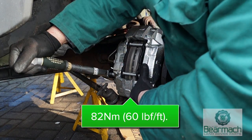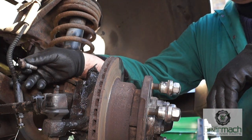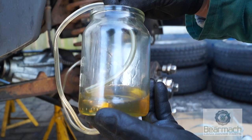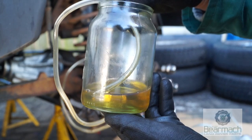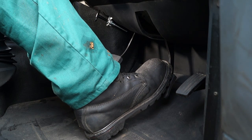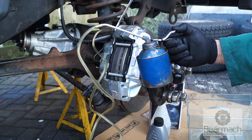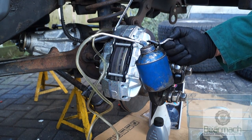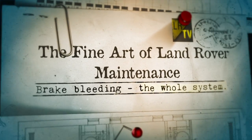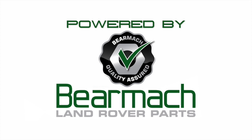It always pays to use your torque wrench to check the torque after tightening. Changing the calipers means letting the brake fluid go. The pipe could be clamped, but in this case we took the pipe off and let the fluid drain. This subject is quite lengthy so we've split this video into two halves — the first about tools and techniques for bleeding, the second more advanced using back bleeding to get an effective brake if you can't get air out of the system.